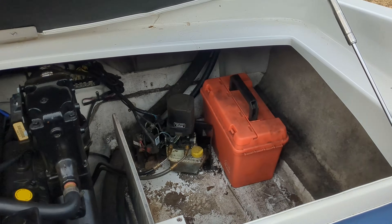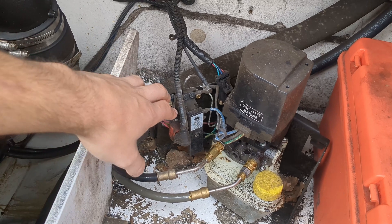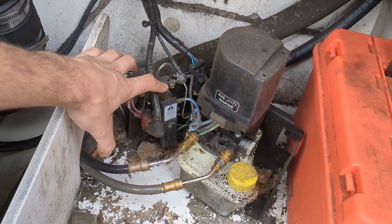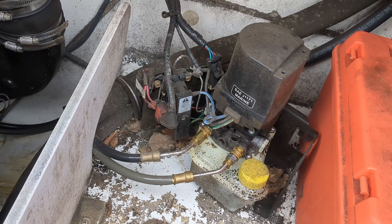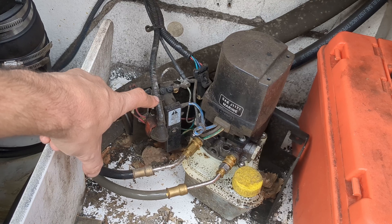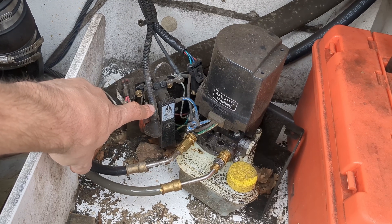The reason for that — this is your trim pump. This is basically the same on every MerCruiser drive. There are two little solenoids right down here, and one switches to provide power to go up, the other switches to provide power to go down. It's a reversing system. If one or both of those solenoids goes bad, you can lose one direction or both directions of travel. It's rare to see the motors actually go bad — it's quite likely the solenoid.